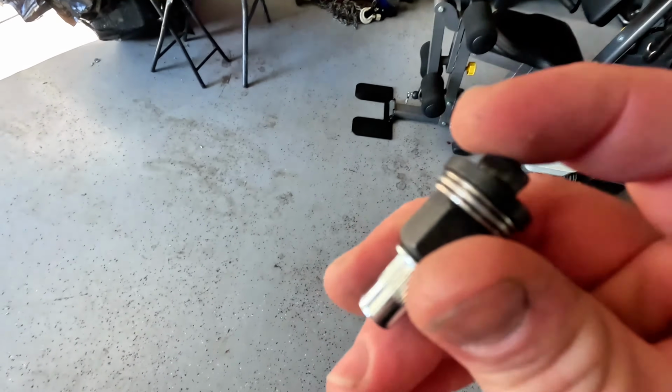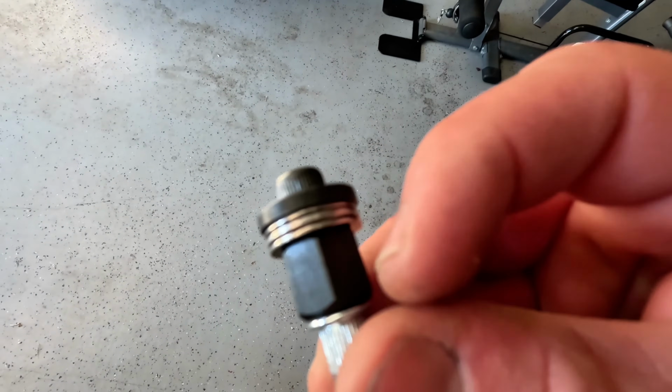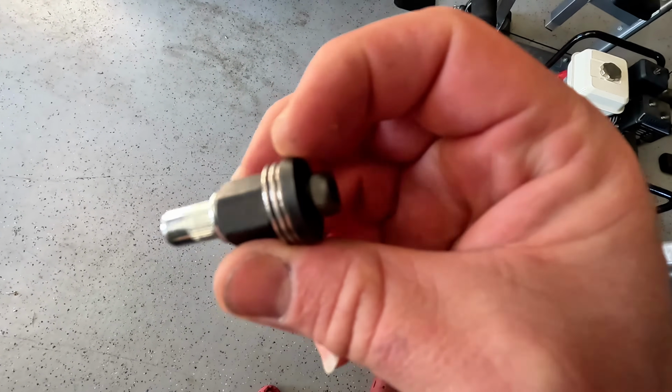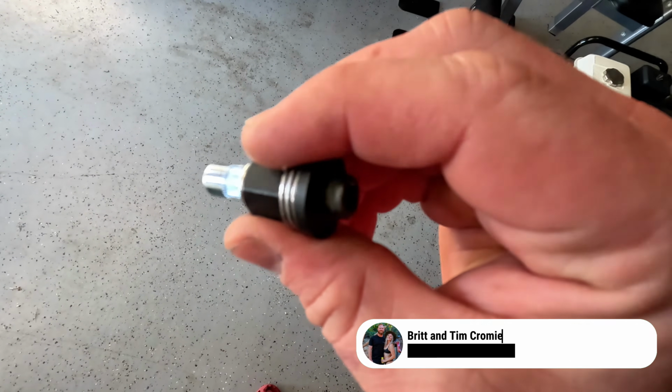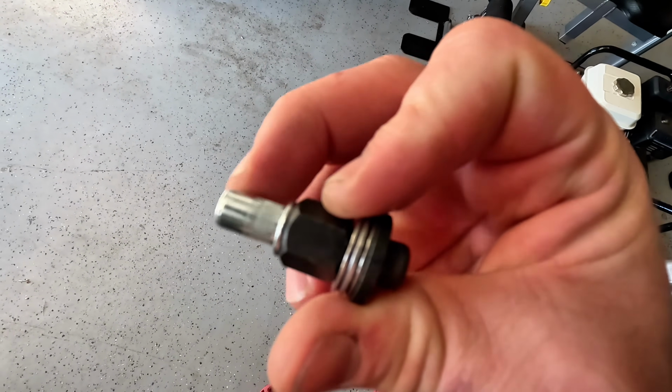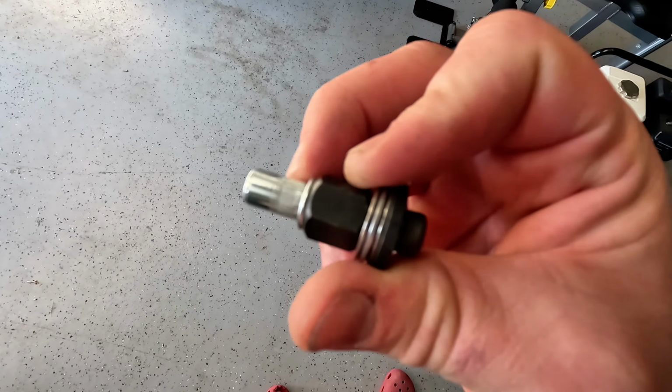And then I'll be installing this, which is a little nutsert tool that they have supplied with it. A little bit hard to see there, but it's essentially a lock nut with some washers, and there's like a bearing race on the inside to help it turn. Pretty much put that into the hole, hold this with a 14mm spanner, and then do up the cap head bolt here. That'll crush up your nutsert and secure it in the hole you just drilled.